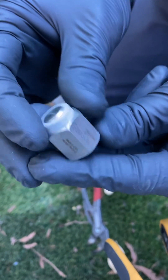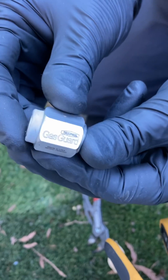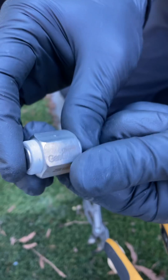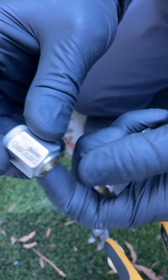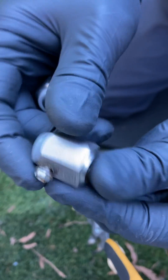Gas guard caps — everybody loves them, everybody loves to hate them. These caps were discontinued because the internal mechanism would bind up and you couldn't get the cap off. So what you would have to do is add a screw to engage that mechanism.